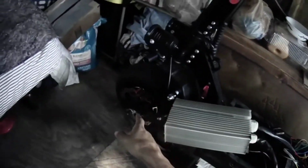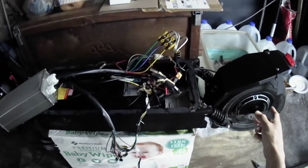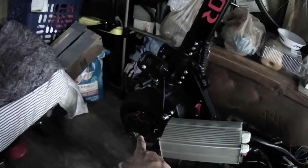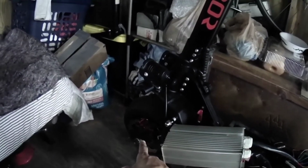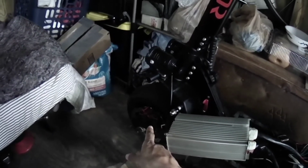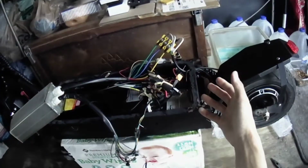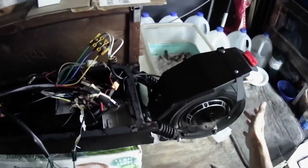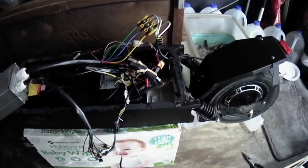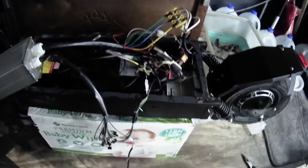But if you have the front motor running and not the rear motor, then it becomes unstable. Especially when you accelerate and turn at the same time, it will easily break traction and you will fall. It's much more dangerous. That's why by default only the rear motor turns in single motor mode. In dual motor, you have both motors turning.